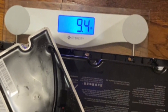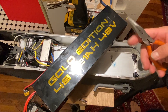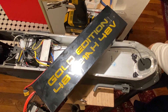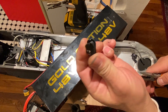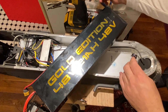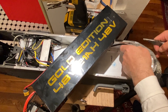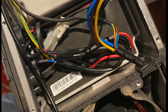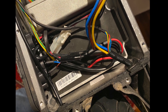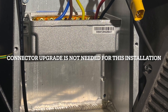Next, we remove the cable seal on the scooter neck to easily pull the wires that go from the controller to the dashboard. Now we can move the wire away so we can see the battery properly. We then remove the recharger from the stock battery, and as we can see, that space is now empty.